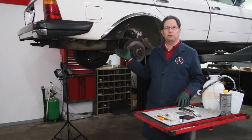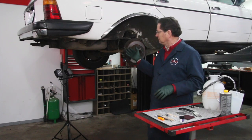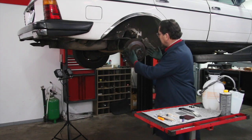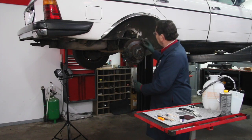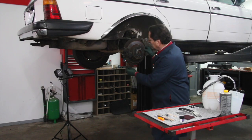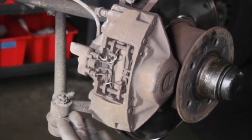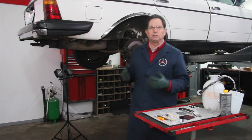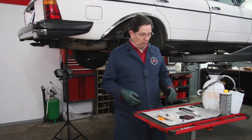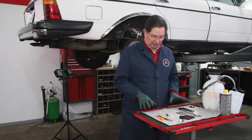And that's the case with this wagon here. I wasn't even planning to work on the brakes — I was just under here working on the SLS suspension and started looking at the brakes. I can tell the pads have been dragging because of the wear on the rotor. Looking in here it's all gummed up and rusty where the pads sit in those grooves on the calipers. The pins are rusty, the spring clip is rusty.